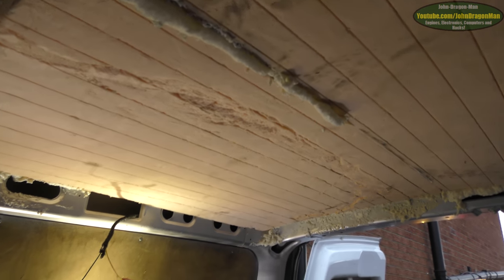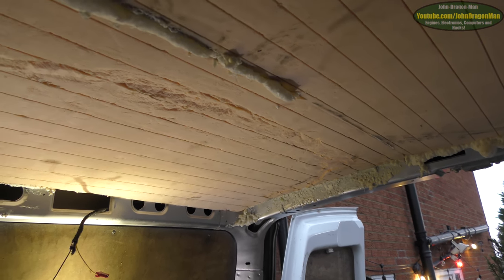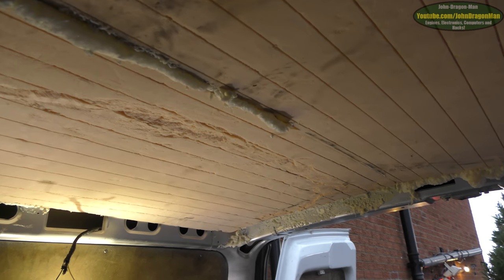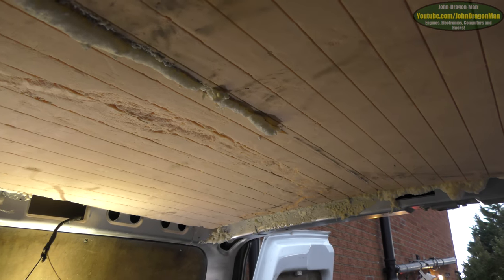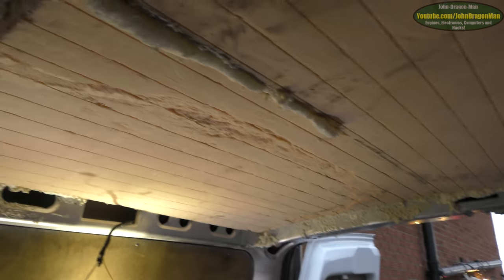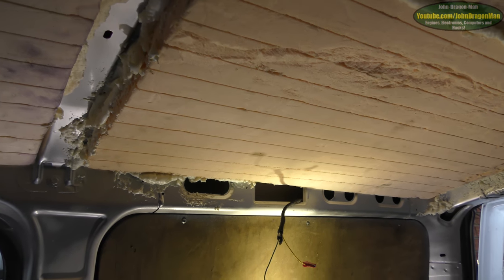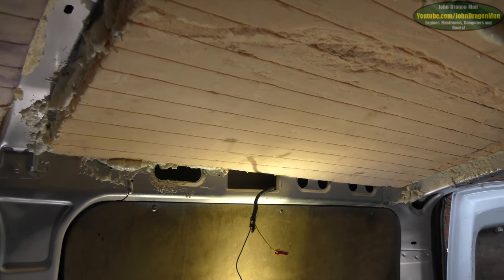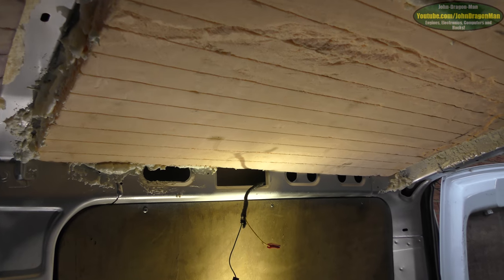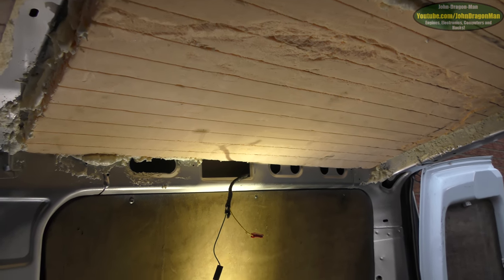It's a different vent - the original one, the UV from the sun had damaged the plastic. The white plastic on the vents is well known for being UV damaged, whereas the black ones just keep going and going. I already had one from years ago stuck in the shed down the garden, so I went and got that and spray painted it white to match the van. After 20 years of it being in the sun it may become susceptible to UV damage, so I put plastic primer and spray paint over it - hopefully that will prevent any UV damage.